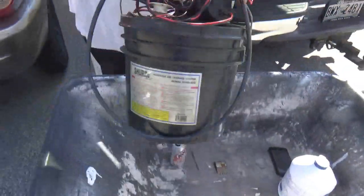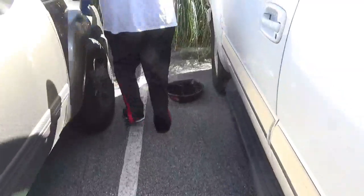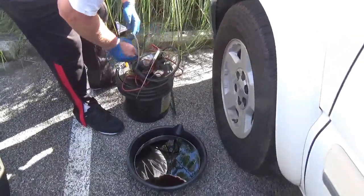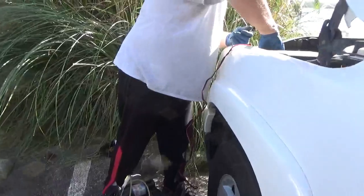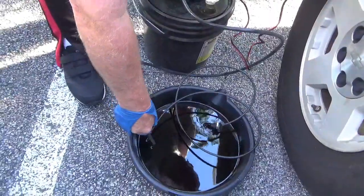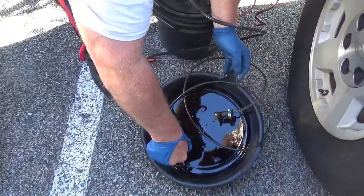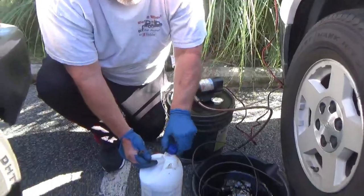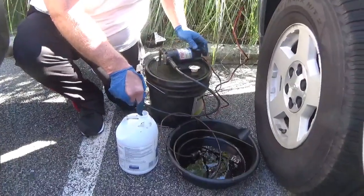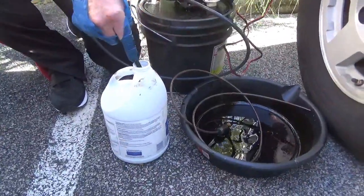What you got? This is my oil change bucket for the boat. Seeing how you can't get under the engines in the boat, you have to pump it out. You hook it up to your battery — yeah, it's an electric pump. Put the pump in reverse. Look at it go. Put it in an empty bottle and then you can take it to the oil change joint to dispose of it.